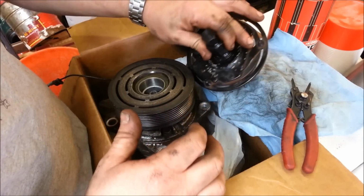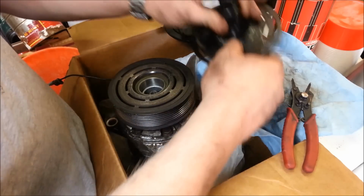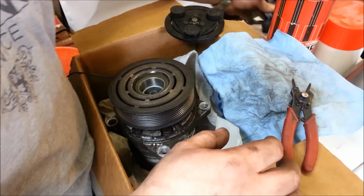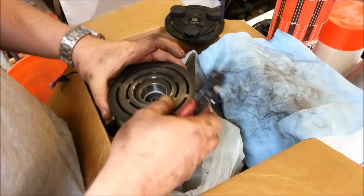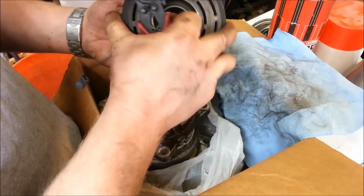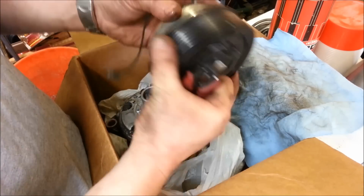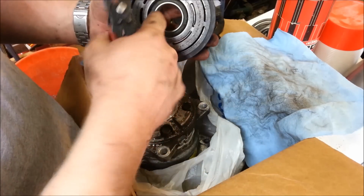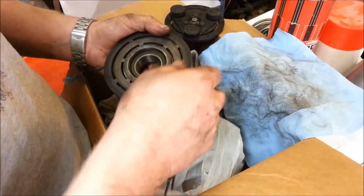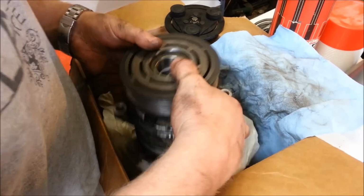The second part is a little more difficult. Well, actually this is probably the most difficult part. The second part is usually held on, and that's your main electromagnet slash pole. Well, this is your electromagnet, but slash your pulley slash your clutch bearing, and that is generally retained with a snap ring. Let's see if I got it in here, right here.